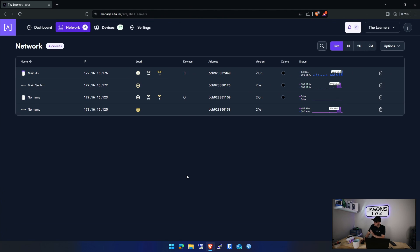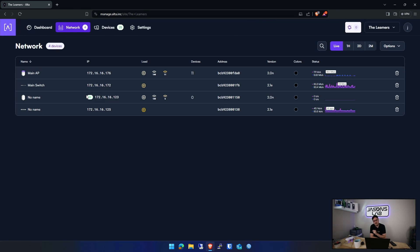We can take that cable off and it will auto mesh back — takes a couple seconds. They created their own special 5 GHz backbone network to do this, so that way it's reliable. You don't want to put this 2,000 feet away from your house, but if you have one or two in your house — or maybe ethernet to another part like a TV downstairs — this would be perfect for that. Put this behind a TV with a switch and it'll give network connectivity down there. As you can see we're now back connected with meshing and I'm online. If you have any questions or comments let me know — I've run this stuff in my house for the last year without a single issue. See you guys later.